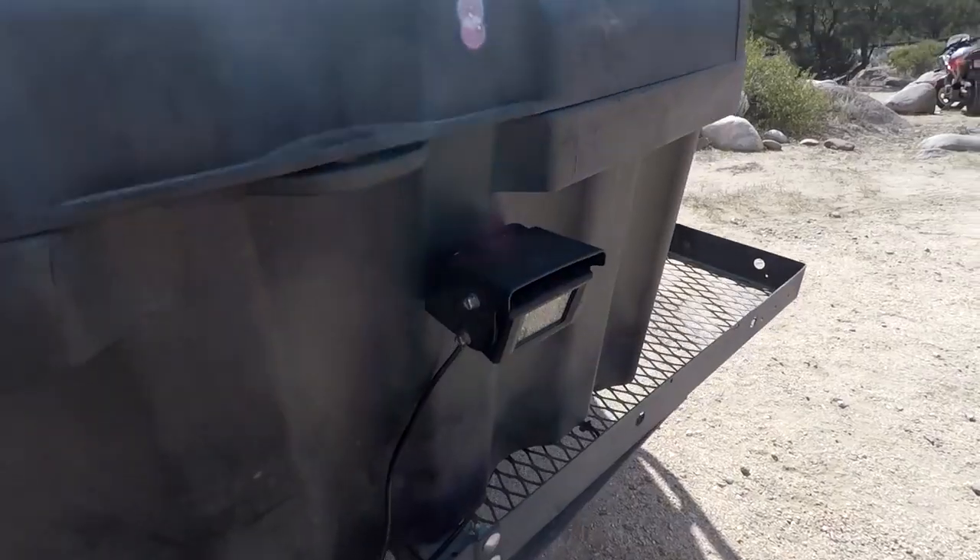This is where the install gets a little vehicle-specific — you need to find a power source and ground to tap into. In my RV I have an accessory panel, and it's a good idea in general to install one to keep wiring clean. It's also good to note that power for the camera is carried by the camera wire itself. The other wire labeled 'camera' is just a trigger — so if you want the screen to come on automatically when you go into reverse, tap that into the reverse line. Then route your wire all the way to the back of the vehicle following a convenient existing cable run.